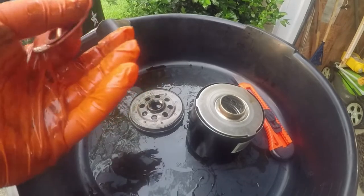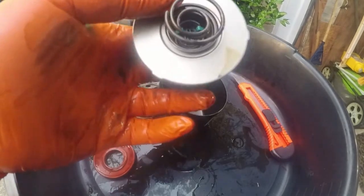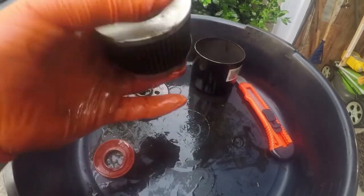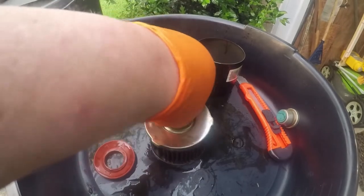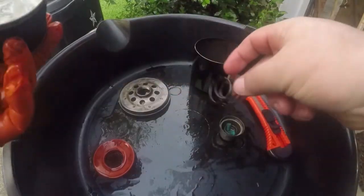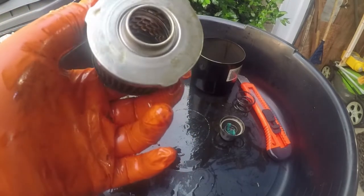The anti-drainback valve is still coming in nice and pliable. It's got a coil spring — that's a different design, I haven't seen that before. You've got the little bypass valve that goes in there, and the coil spring that holds it in place. Interesting design. It does have the louvered interior; some people don't like that, I'm not crazy about it, but the louvers look very well opened up and should have good flow.